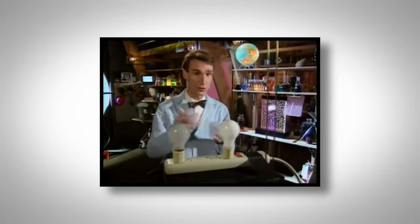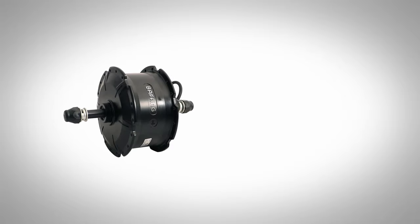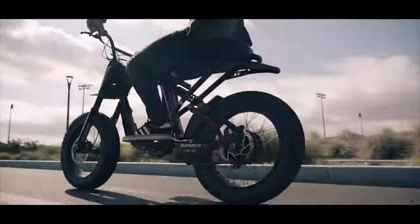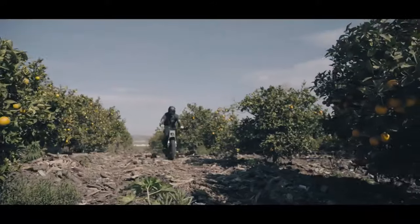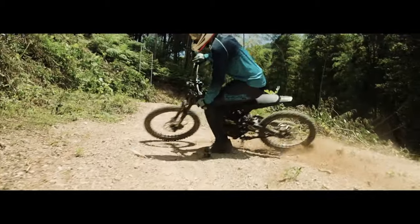The combination of volts and amps we call watts — the more watts, the more powerful the motor. There are some exceptions depending on other bike components and what type of motor it is. For example, an e-bike with a 1000-watt geared hub motor will normally be slower than an e-bike with a 1000-watt mid-drive motor. Because of e-bike regulations, the de facto motor size is 750 watts, but due to vague restrictions and lax enforcement you can easily find e-bikes sold with far greater wattage. Some manufacturers will list the continuous power at 750 watts, however the peak power can be much more.